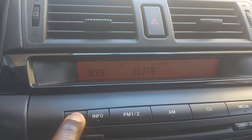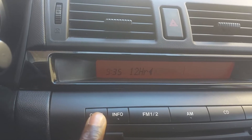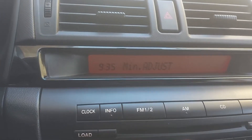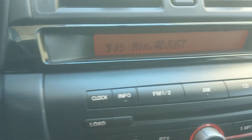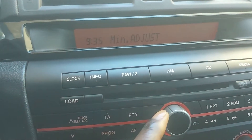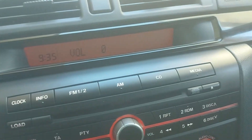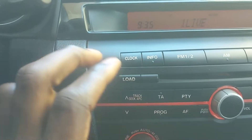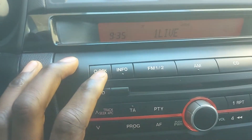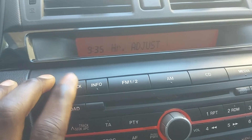The YouTube videos I found were for Mazda 2. They said you press and hold the clock button, it brings up the hour, then you click it again to bring up the minute — you see the minute is blinking. Then they said to change the minute you use the radio select button. But when I tried that, the select button doesn't work — clicking it just stops the blinking. So it took me time to figure out myself how it actually works.